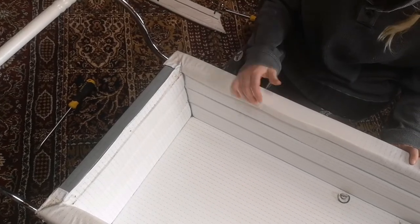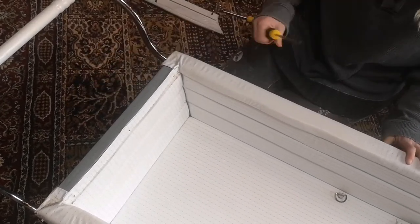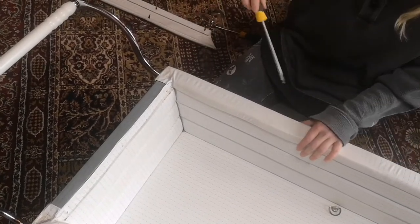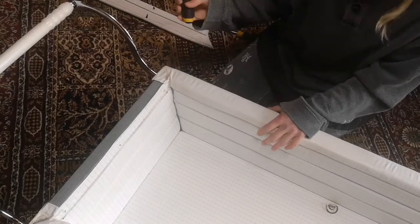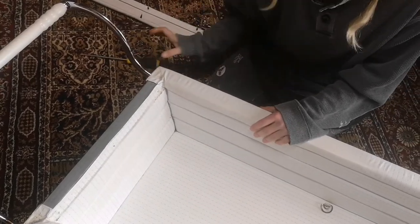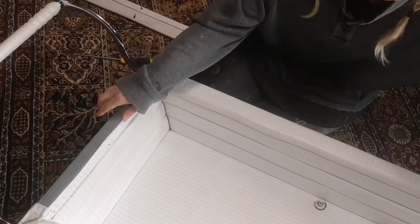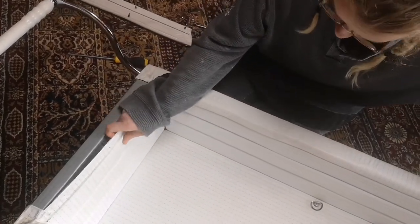Find your own way to do it. If you're using a flat-head screwdriver on the outside, just be careful you don't slip and scratch the paintwork. Similarly on the inside, be careful you don't rip your liner if you're going to keep it. Once you've done that, you will be able to lift the whole bed unit out.